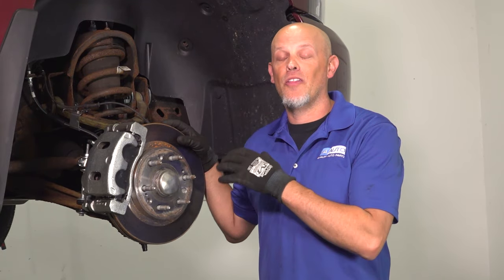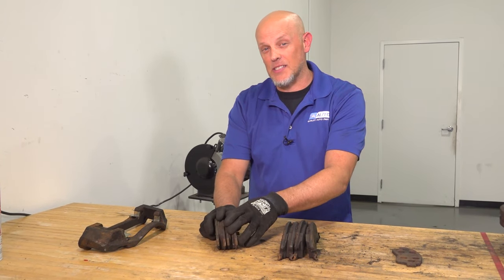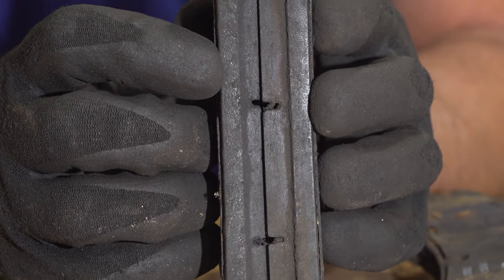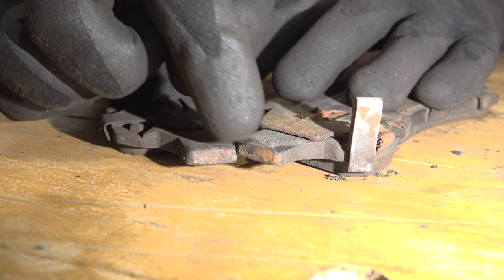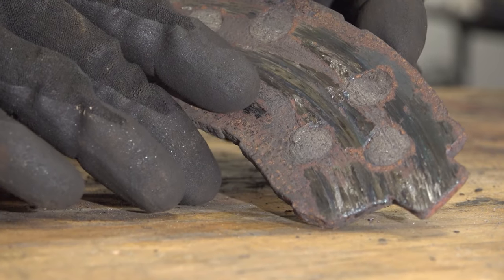I'm going to take the bracket off. You may think that when you have uneven brake wear it's caused by the brake pads themselves — well, that's not normally the case. It's due to other brake components. Let's check out some brake pads. Here we have some examples of uneven brake wear. These pads are worn unevenly; you can see one side of the pad is thicker than the other. With this example, you have one pad that's extremely thin compared to the rest of them, and if this situation continued you're going to end up with one brake pad grinding metal to metal on the rotor.